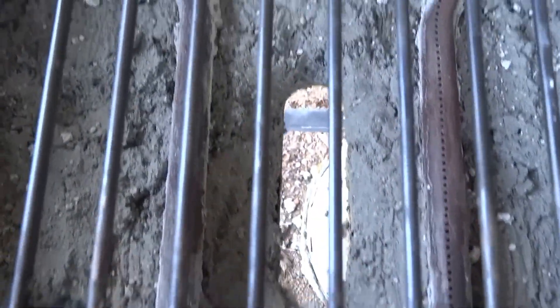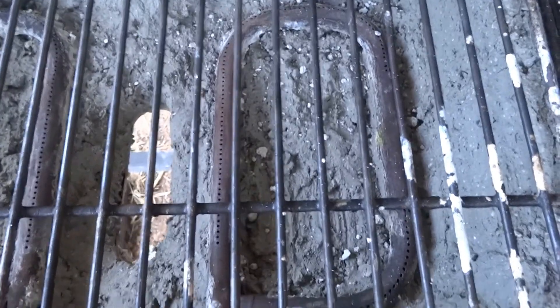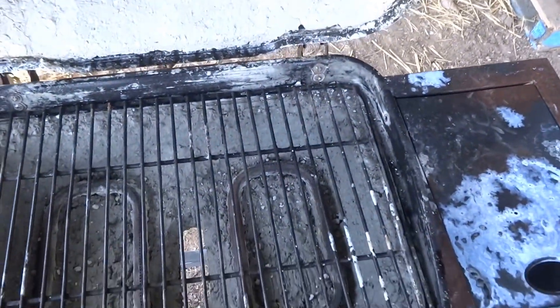I left the middle hole open to make sure I had enough oxygen flow in there, and then I had to use a wire brush to clean off all the holes in the burners on both sides. I fired it up just to make sure it was all running and had to brush it off a little more as I went, and got it where it all fires up. So it looks pretty good.